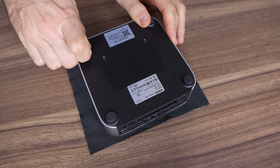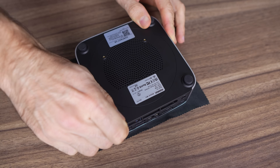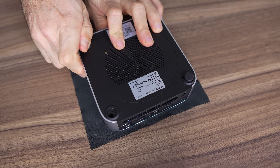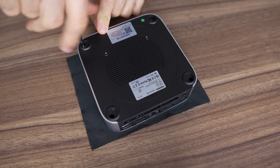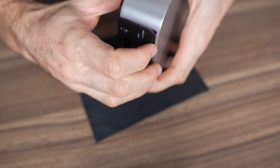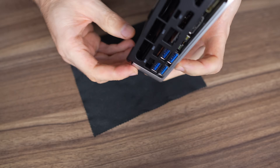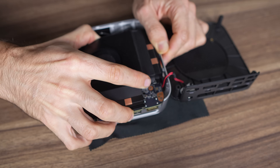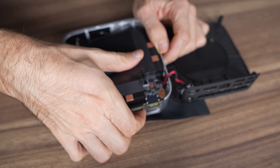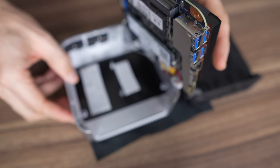This is one of those minis where opening it is a real chore. Instead of easy and painless access to memory and storage, it's a pain. There are four tightly glued rubber feet to remove, then four screws. You'll need to give a little tough love to the black bottom section to get it to move, then pull on the side of the case until the cooler is no longer locked in place, and wiggle it out while watching out for the wireless and Bluetooth cables.